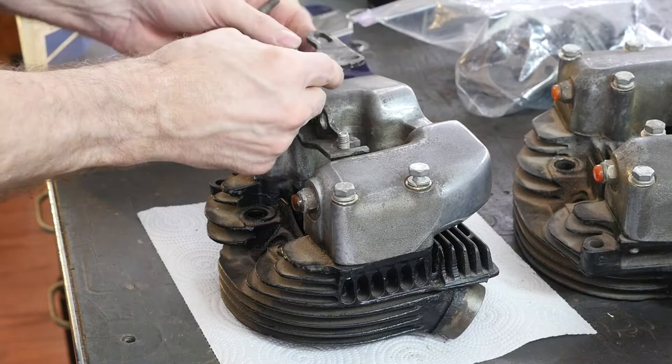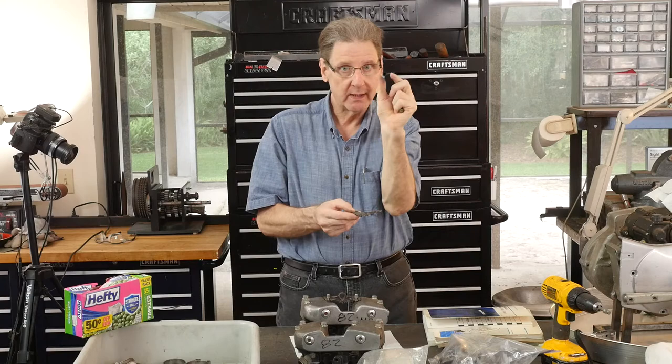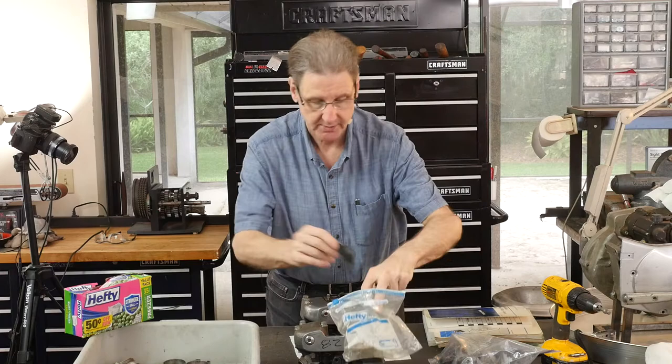You can see I took a torch to this to bend it — to get it parallel to the bottom of the fork, the front frame — and to allow just the right number of washers to slip in. Same thing: you're not prying up on this. That's just a formula for disaster.